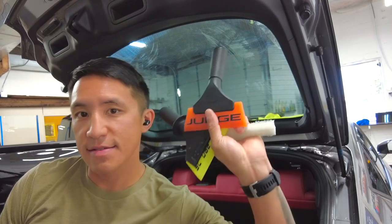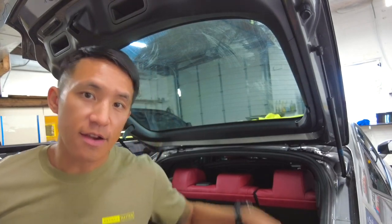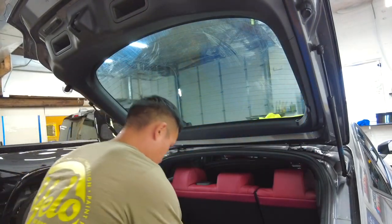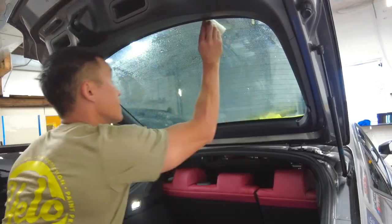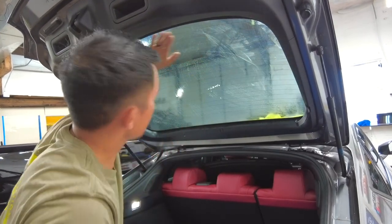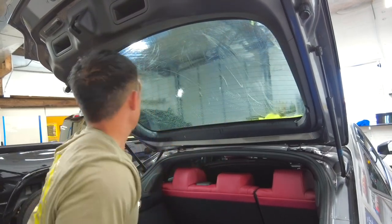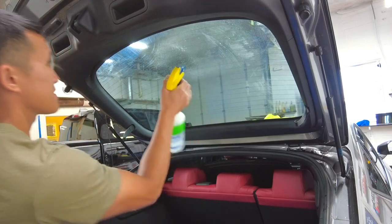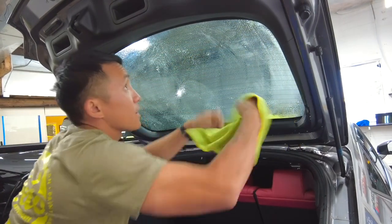For the back windows, easy install — we're starting with that first. I'm bringing both squeegees: a soft squeegee, a hard squeegee, and a white 3M scrubby pad to clean the back glass. I don't want to get it all wet down here so I'll just throw a towel down. Spray the glass, use the scrubby pad, and feel it with your hands — sometimes there are stickers because dealerships put temporary tags or plates back there, so make sure there's no tape residue. Final spray before installation.